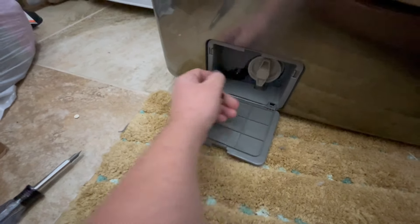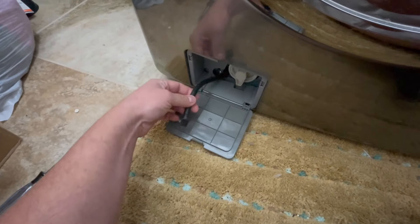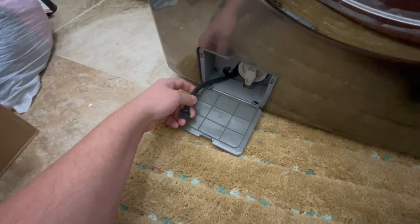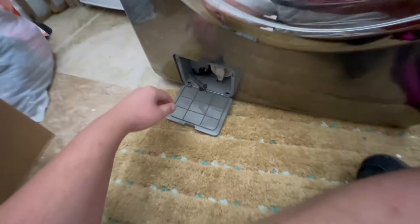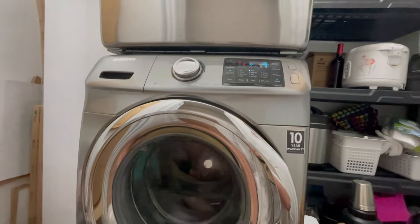See right here — there's a little hose that clips up in here like this, and that is a little discharge tube. What you do is pull that little plug and drain it out into a flat pan, put the plug back in, empty the pan, then pull it and drain a little more — just over and over until it's empty. If you have one of the foundation bases on this, it's much easier because you can just drip it down into a Tupperware below. But when it's on the floor, you've got to do it slowly into a flat little pan, which totally stinks.